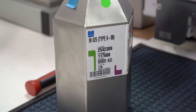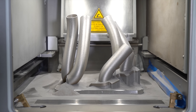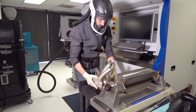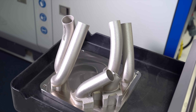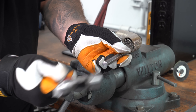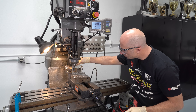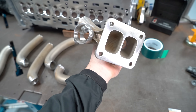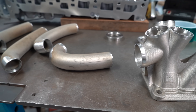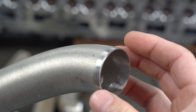Once the print was done, you can see how all the tubes and the flange are stuck to the plate — they're actually welded to it and have to be cut off. In addition, there is what they call support material that has to be hammered out. For the flange areas — the surfaces that mount to the turbocharger and cylinder head — I put them in the mill and machined them nice and smooth. All the areas that are going to get welded got sanded down and cleaned really well to ensure good areas for the weld to fuse together.